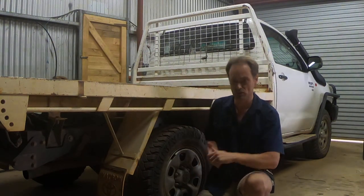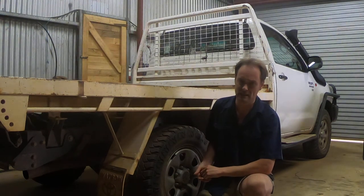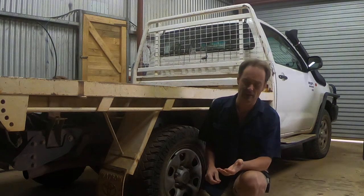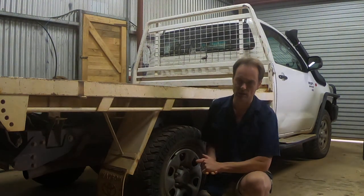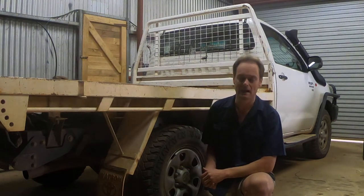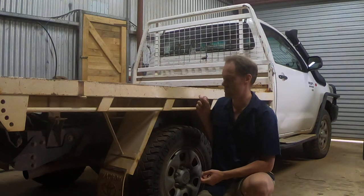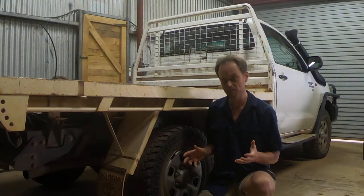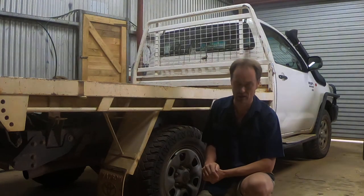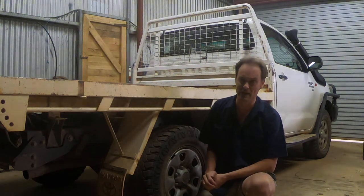With a tub, you lose some area — there's just no way around that. You do gain some depth, but one of the big advantages is that by default it's quite easy to have a level of security with a tub. It's a little bit more difficult and expensive with a steel tray. What I mean is you can get roller shutters and roller tonneau covers that have a lock, so you can lock them up with a hard surface. You can get a lift-up hard tonneau with a lock. Can you break into these? Yes — locks are for honest thieves — but it is one level of protection. With a dual cab and a tub, there will generally be a factory option tonneau, whether it's with loops or peel-and-seal, and they're pretty low cost or there are aftermarket solutions. They're pretty easy to fit, and you can get no-drill options too.